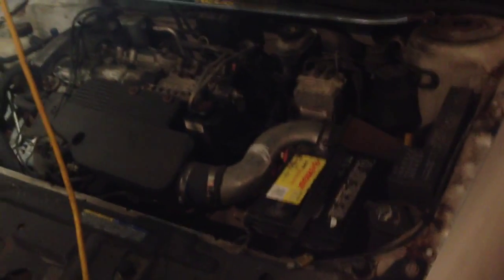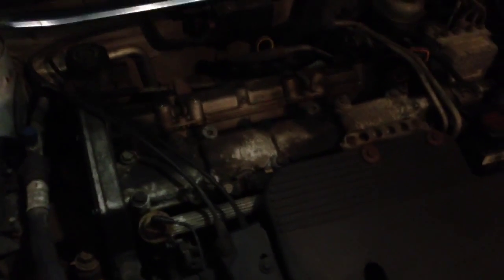And that is how you do a wet dry compression test. Check out my channel, subscribe, comment if it helps you out. All you've got to do is make sure that you disconnect the spark — it's the same on any vehicle. Disconnect the spark, which in this vehicle is this plug right here, plugged into the coil packs on this cover — that's for each of the spark plugs. On other vehicles, you've got to know what wire to unplug. So it looks like we have a burnt valve.